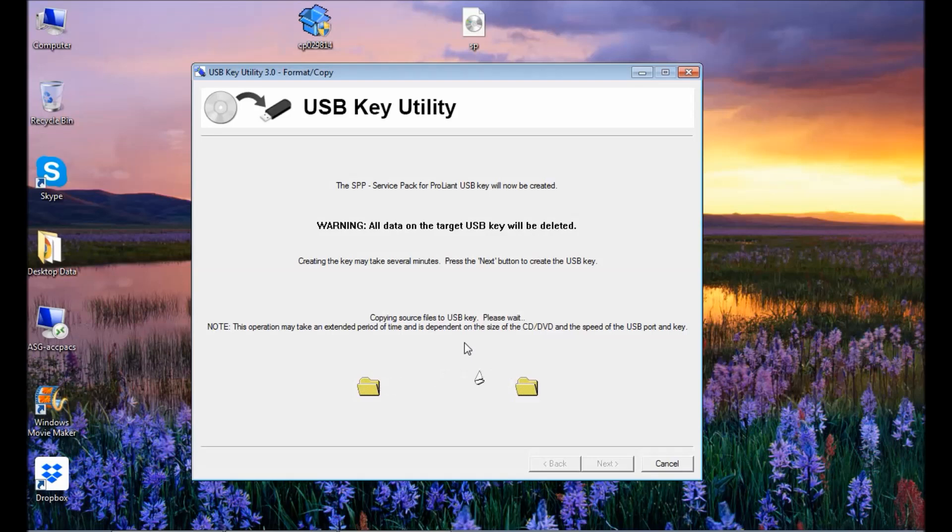It's easy and all updates will go in one shot — your smart storage, array controller, BIOS settings, hard disk drive drivers, and firmwares. All firmware updates go in just one shot. So it's better to make this USB and update your BIOS and firmware through bootable media. It will take a small amount of time.